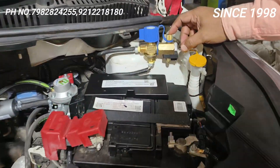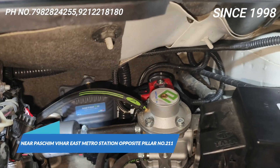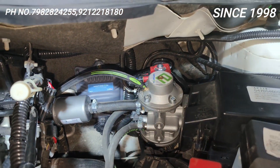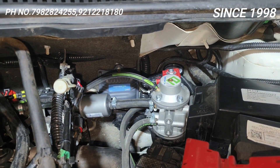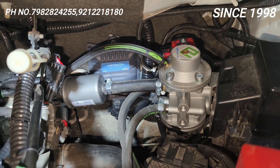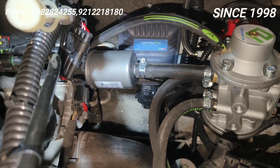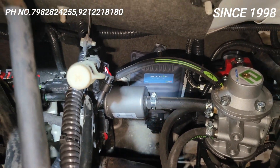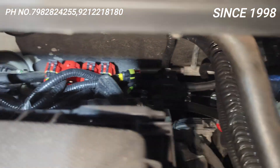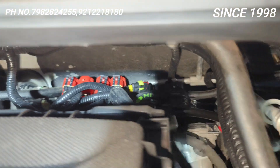This is the filling valve — from here gas is filled, directly on the cylinder. This is your reducer, double stage — whatever gas comes from behind comes at high pressure. It's all a matter of the fitting and placement of the parts and the extra accessories that need to be added. This is the filter so all impurities get filtered out. Behind it is your manifold absolute sensor — the MAP sensor — and the injectors are placed here.